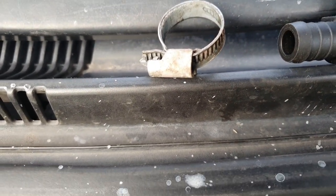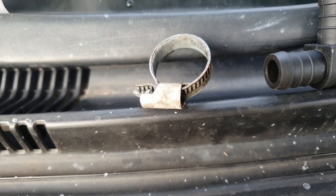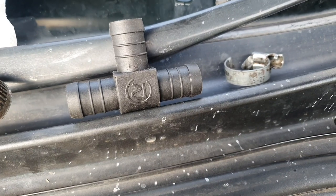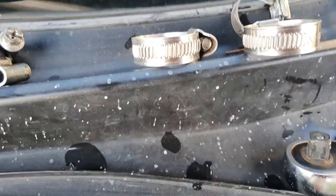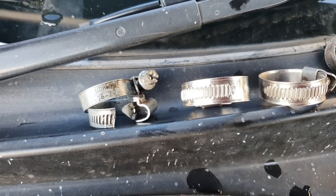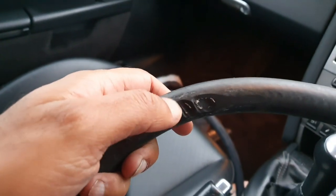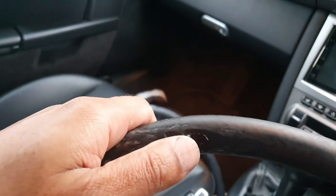These are the Jubilee clips I was using. This one is actually knackered — it's lost its worm drive — so these will be replaced with new Jubilee clips. One thing to mention: you can over-tighten them, which will pinch and distort the hose and lead to a leak, or crush the plastic attachment. So this vertical hose here has been rubbing against part of the car, which has caused it to perforate — hence the drip, drip, drip.